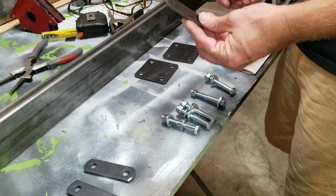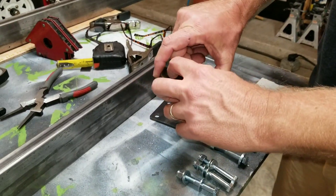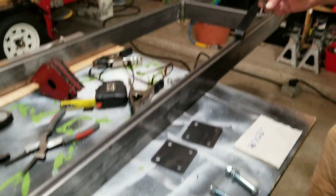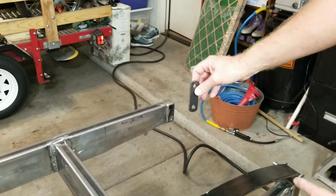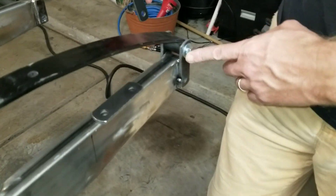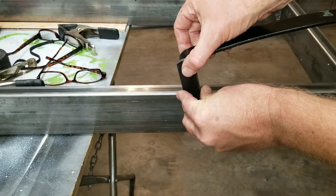These are your shackles. Same thing, these are fence post parts. These are three inches, two inch from hole to hole. There are two places these are gonna go. They're gonna go to the front to mount your spring — you see right here — and they're also gonna go back here. This is gonna get drilled in the frame and this is gonna get mounted.